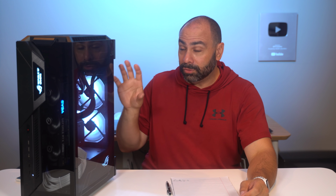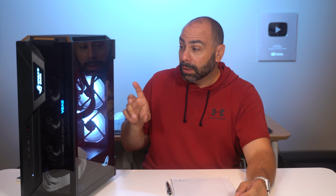The first is thermals. Now, I don't know if you guys can hear this. I'm going to do my best in post to take out the drone of these fans, but this system is loud. And the reason that it's loud is because all the fans in here are running at pretty high speeds at all times. Now, you can definitely change fan curves and even make the fans run at a set speed if you want. But in order to keep thermals in check here, especially for the graphics card, the fans have to ramp up pretty significantly.